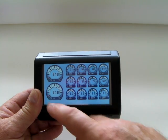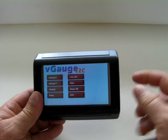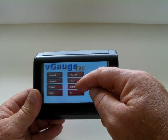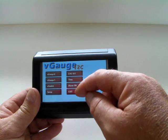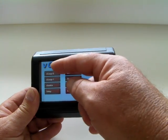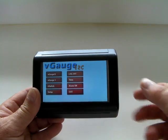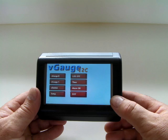Back to your gauge view. On to your control panel, which gives you the options of data logging, setting your time and date. You can fully alarm each of the 12, or up to 16 gauges. This is your exit for on and off. You can preset two different gauge selections, go straight to your switch module, or use setup mode to control how your gauges are laid out.